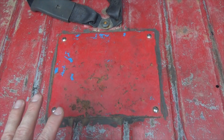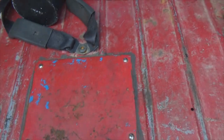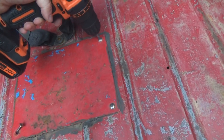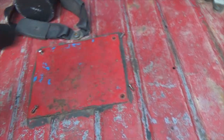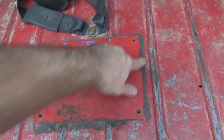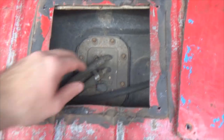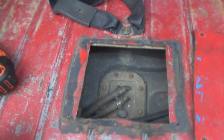I've been asked several times for the dimensions so they can cut this hole for theirs, because I'm gonna show you here in a moment — it makes getting to your fuel pump ridiculously easy. I'm gonna go ahead and pull those screws out right there and show you what's under there. One screw, then I pick this plate up — I've got black silicone like you use on your valve covers sealing it up. Pull that off — right there it is. That's your fuel sending unit, fuel pump, everything's right there. Take those screws out and it all comes straight up out the top. You don't have to drop your tank. It is ridiculously easy.